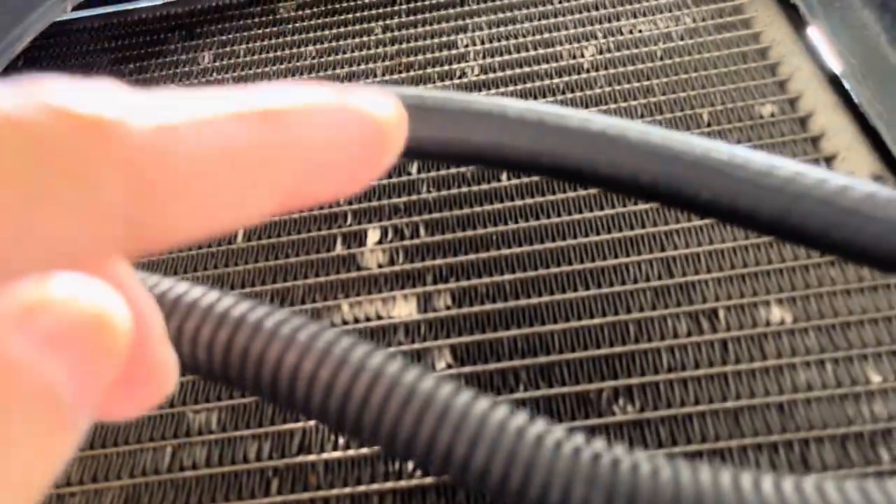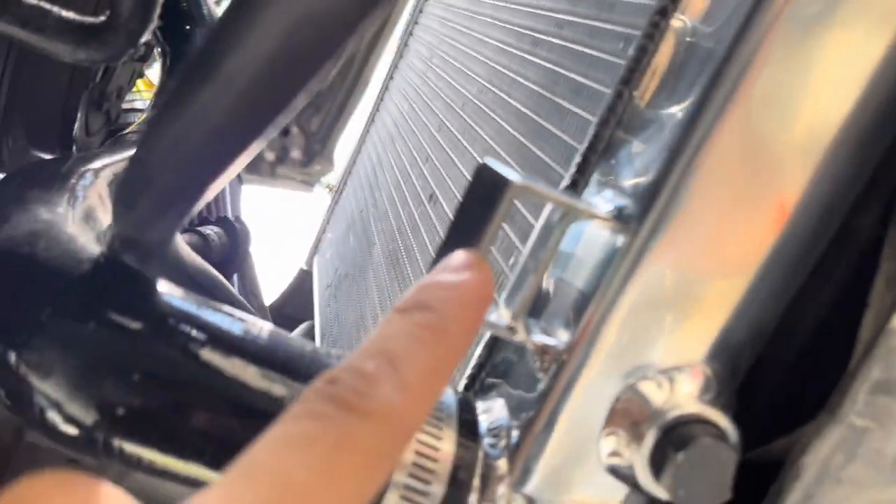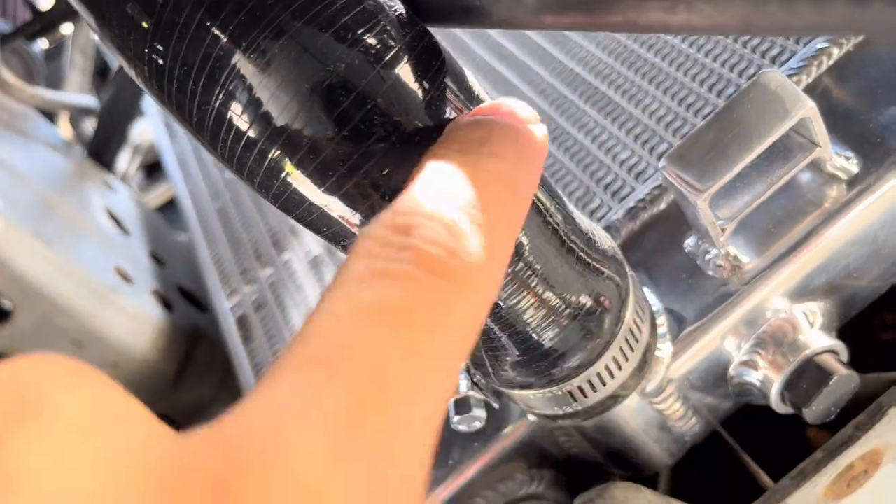You have to lift the AC condenser — I was able to do it by myself but you might need a buddy. You can see this hook over here — this is where the fans will hook, here and over here. But behind that, the AC condenser has to hook in first. So you've got to hook the AC condenser at the same time as trying to hook the fans in. I also noticed this piece is too long, so I've got to cut it since it'll be hitting the radiator.